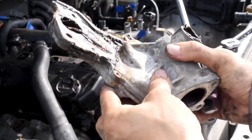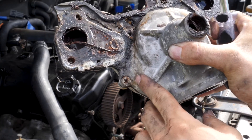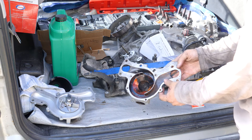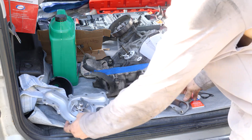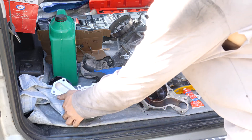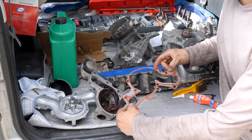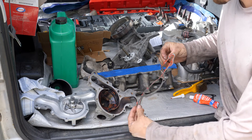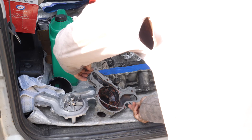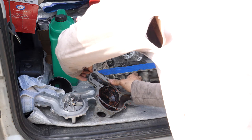The water pump actually comes apart into two pieces — there's this side and then the front side, and there's a little screw on the back side to get them apart. I've got the back of the water pump all cleaned up, got the gasket surface all cleaned up and smooth, and then this is the new front of the water pump that I'm going to install. I've got my gasket with the gasket sealer and I made sure to go around all the holes. I'm going to place it right into the back.